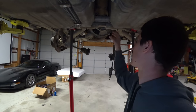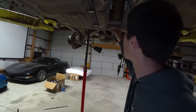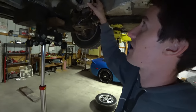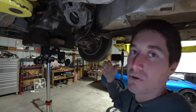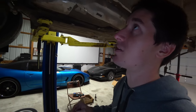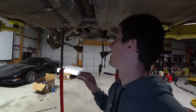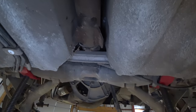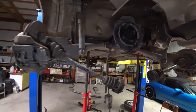It's down as far as it will come down. We've been prying, trying to bring it down slowly, but it's just kind of sitting right there. Our problem now is this will not come apart. The bolt that holds the splines in place is out, we've got the clamp off the splines, and we've tried turning it back and forth and pulling it back pretty hard — giving it a couple of quick jerks — and this thing will not separate. We sprayed it down with CRC Knock'er Loose. Hopefully that soaks into those splines and breaks loose any rust. If it comes back just a little bit more, we can slide this thing out. We need to turn it 180 degrees to get it clear.